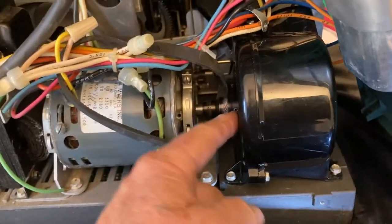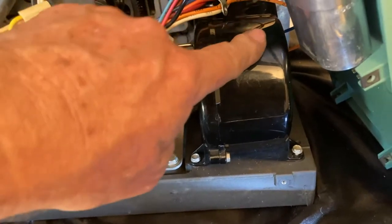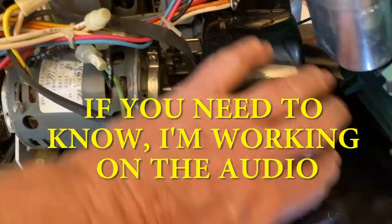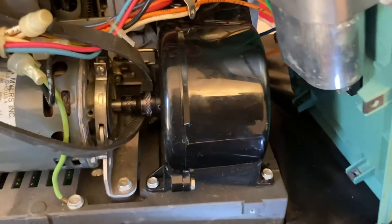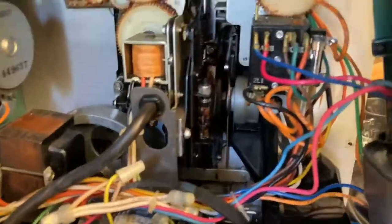Keep these loose, all the different screws that have to do with this housing, keep them a little bit loose. So you have jiggle room to fit them in each corner. You need to be able to jiggle it a little bit. So then once you have all the screws in and finger tight, then go in and tighten them all up on the fan housing.